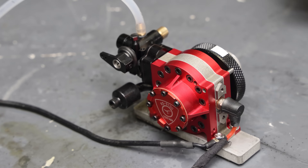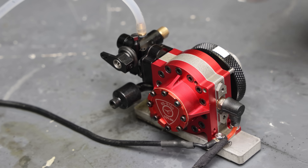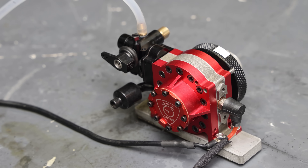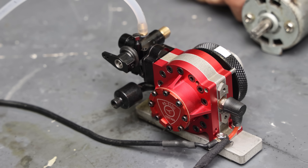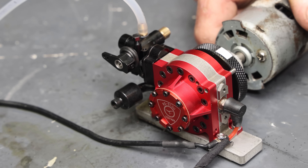All right, I've got the tachometer ready. I have my little piece of reflective tape on the flywheel. I'm going to start it up again and just go for the gold — full throttle, just like the rotary likes it. Let's see what RPM this hits. I feel like it has a little bit of low compression, which is pretty common for rotaries in general.